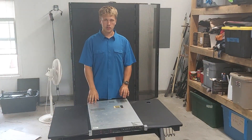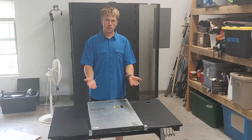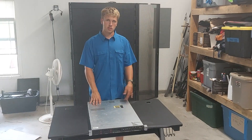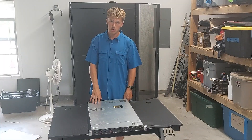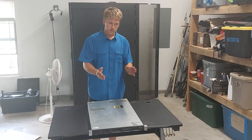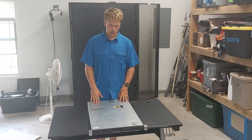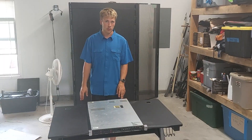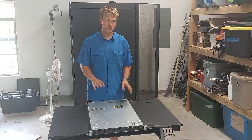Alright guys, we've got the first one here, which is the DL360P Gen 8 — a 1U server. This is a small form factor, so it comes with an 8-drive bay. This is a large form factor — it's a 4-drive bay, because you can't cram a 3.5-inch drive into a 1U space. These are running dual E5-2640s, which is about 2.5 GHz — I actually like the processors, but it's slower for the grade.